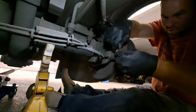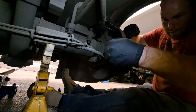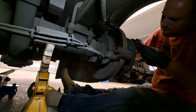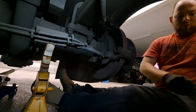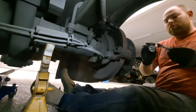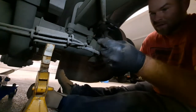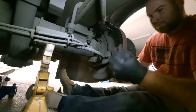These guide pins are hard to move — I'm putting a lot of effort in, and that's no good. I'll pull it out. If the caliper has encountered petroleum-based grease, it'll swell the seals and stick really bad like that. So this is what I use: 3M silicone paste. You can use brake caliper lube — it's going to be silicone or ceramic based. You can't use regular grease. If you use petroleum-based grease like wheel bearing grease, you're going to have a lot of problems.